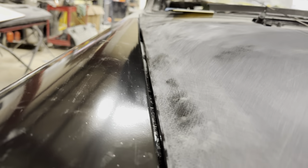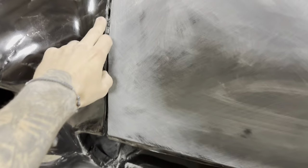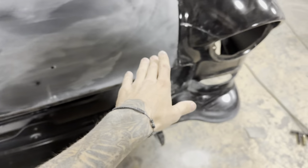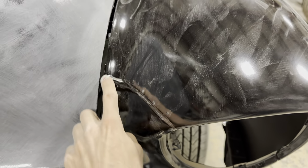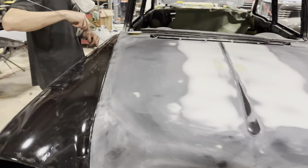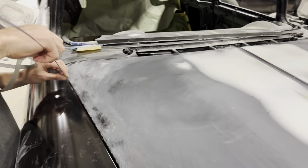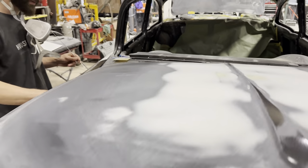And the gap near the back of the hood. Not good. Yeah, a little too wide. But then it tightens up to about here. And we've already measured the core support and set everything this side. The gap is great all the way up, other than this pocket where this is separately welded on. So we're gonna have to do essentially the same thing there and add a weld rod. So that's what Jesse's doing. Did you drop your rod? Yeah, we're smart.